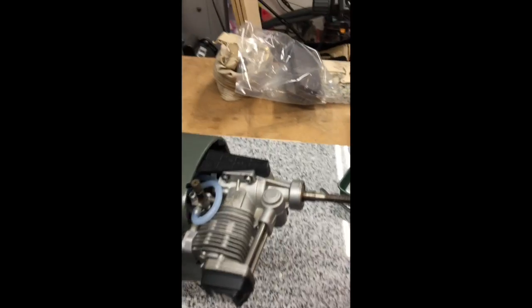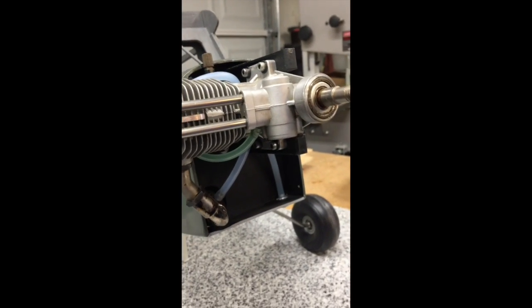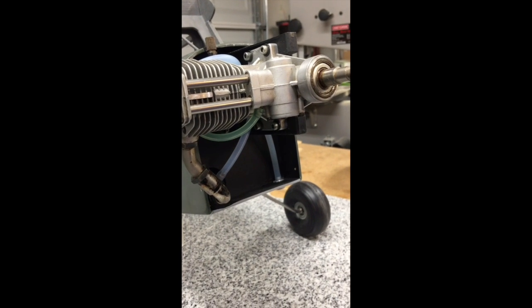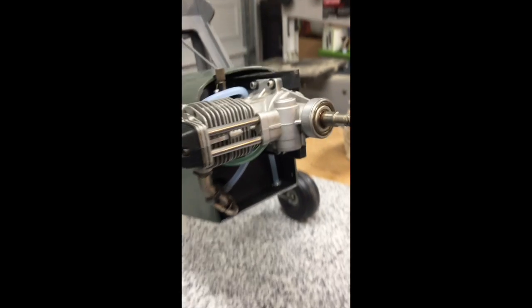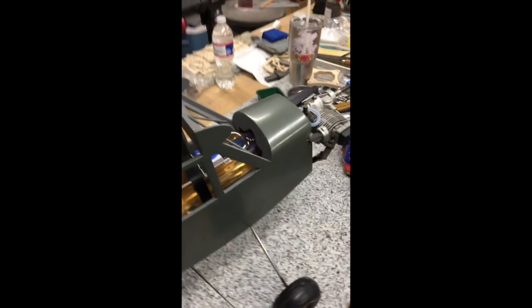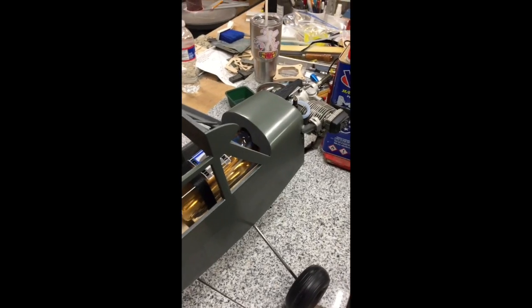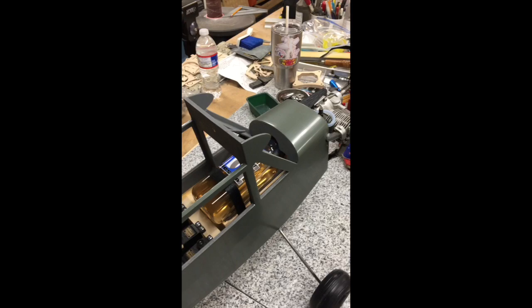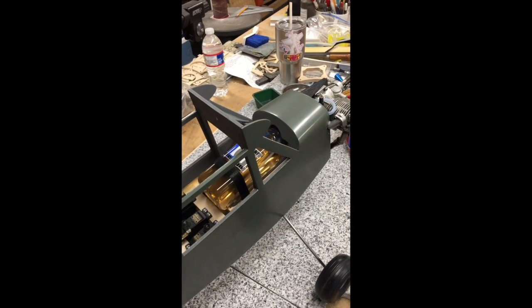Just make sure you keep your installation nice and clean and run your fuel lines to where they're never touching the muffler. This applies to gasoline installations also. A lot of what we just discussed in this video you can use on the gasoline tanks too. The mount's the same. The plumbing's a little different, but the tanks and the mounts are the same.